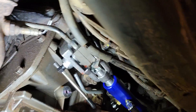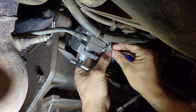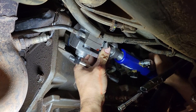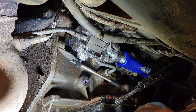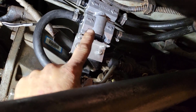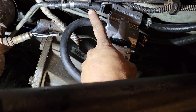And there's the final install. It comes out of the trans through the bottom hose and goes in here. Until the thermostat pops open, the fluid just goes up into the radiator. When it hits 180 degrees this will open up, the flow continues straight through, goes to the cooler, comes back out, goes to the radiator, and then back into the trans. That's how it works.